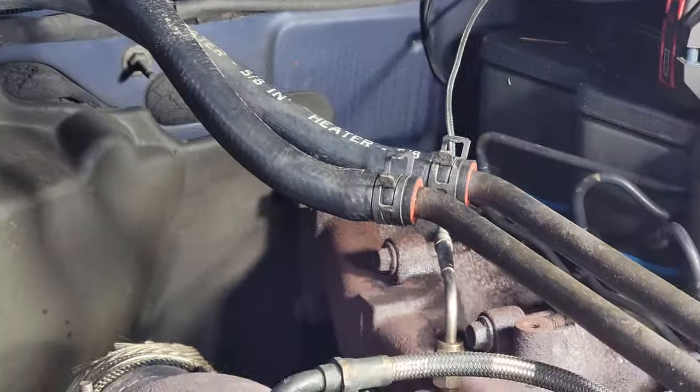I need to drill the hole for the standpipe now. I'm going to put it right around here and have the standpipe go down to about an inch off the bottom of the tank. This is towards the frame rail so the fuel line can just run and tuck along the frame and meet up with the fuel pump in front of the tank. Here's the finalized install on the fuel tank — the standpipe is just here and I've already clamped the fuel line so once it's up there I can just pull the fuel line back and start zip-tying it to the frame.